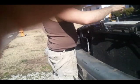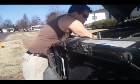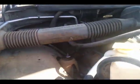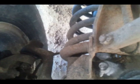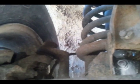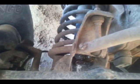So what you're going to want to do when you start off is spray the bolts a little, because there's a lot of stuff that happens. You need to break them free. Two of them are going to be really easy, so you could do an open end wrench. They're going to be right there. See them? Here is the lower end. It's right here. I'm going to blast them with some liquid wrench penetrating. You can use WD-40. I like the liquid wrench a little better, but I use them both together while I'm doing it. Alright, so I'm going to lift this up.